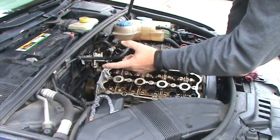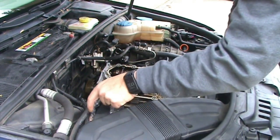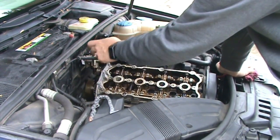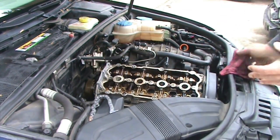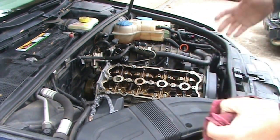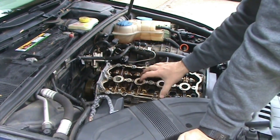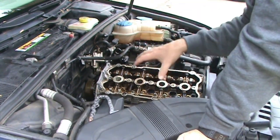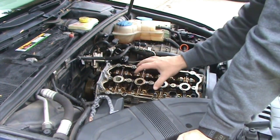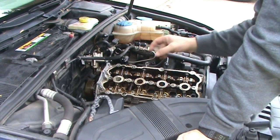I should only have to do it once, and then you rotate through twice to check timing, and that gold link should move from the mark on the exhaust cam over to the intake cam mark, if it's timed correctly. If it's not, you have to do it over again. So that's what I'm trying to avoid, is once I put this on there, I don't want to have to pull it back off. Although I might do a test run with it, pull it back off, put the RTV on it, and that's